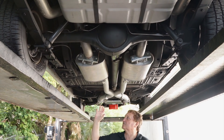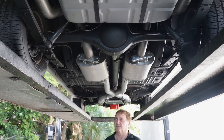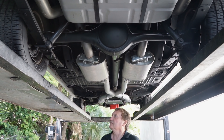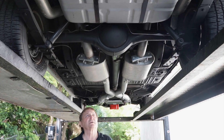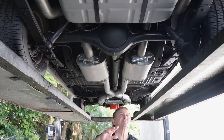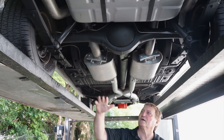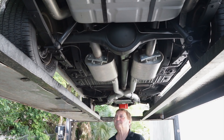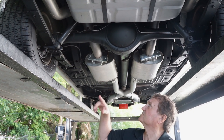The torque boxes are just as clean and clear as you'd ever want to find. All the original rubber plugs in the floor pans are still intact. The rear end is an eight-and-three-quarter heavy-duty Mopar rear end — I don't know the exact ratio but it's a higher highway gear rather than a drag race gear. The springs have great curvature — they almost look like super stock springs. New shocks front and rear. With these springs they don't need air shocks or anything.